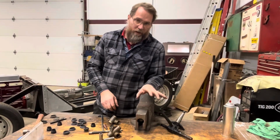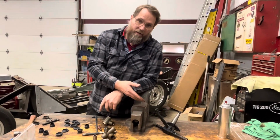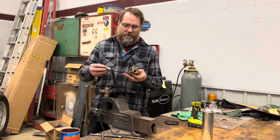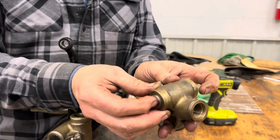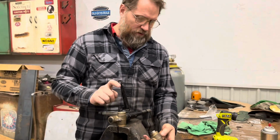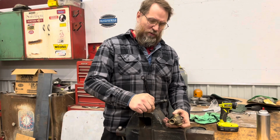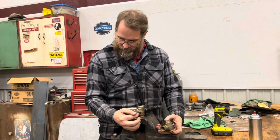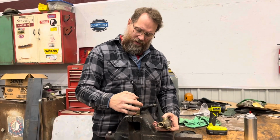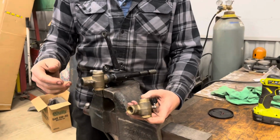And if you don't lubricate them, they will be stiff, and over time get stiffer as water gets in there and corrodes things up. So you always want to make sure these are sliding through here pretty nicely. Like this bottom one was absolutely not. It was stuck in there. And that's why it doesn't move, because whoever took it apart before didn't take that one out, and it did rub along at the edge of the thread a little bit, so it doesn't turn as smoothly as it could.